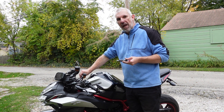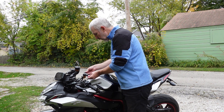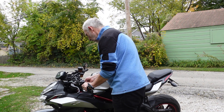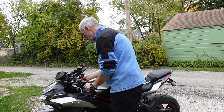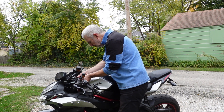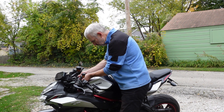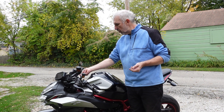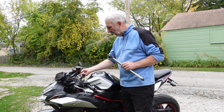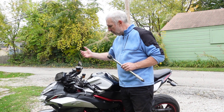We've just loosened the top hex because we're going to now slide the damper into place. Let's turn the handlebars to do that. There we go — that's slid into place fairly easily, so we just need to get our bolt in there with some thread lock on and get that torqued up. We've got that torqued up now and the next thing is just to adjust the gap and get this tightened down, and then I think we're putting everything back together again.